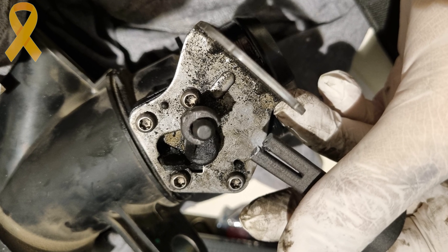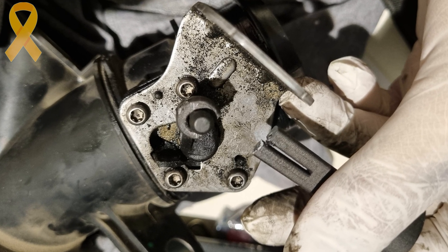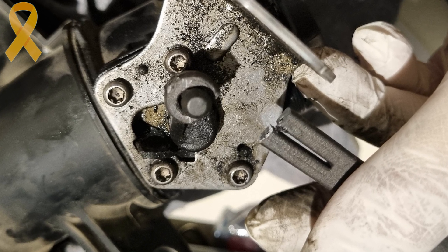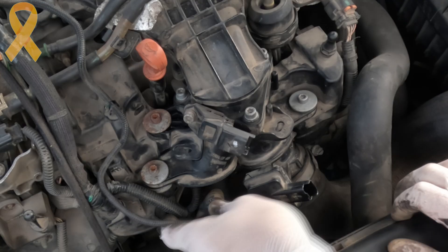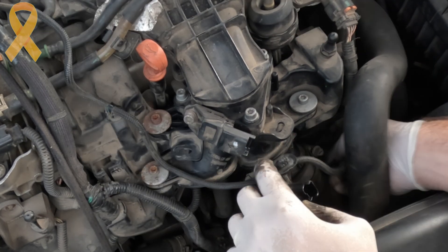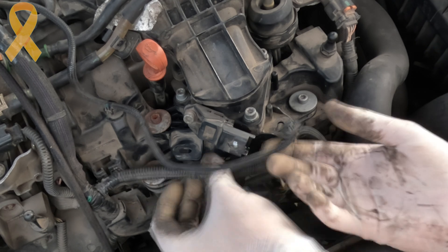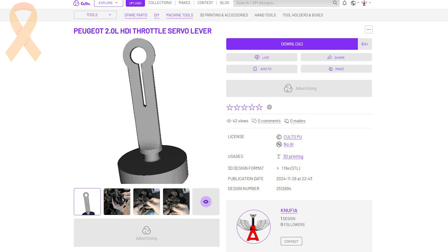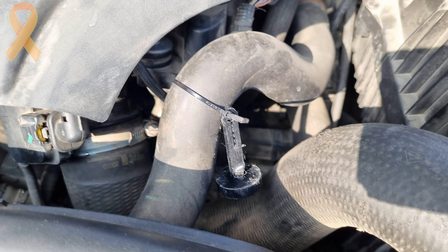At first I made the lever from a heavy duty industrial material called onyx. It's heat resistant but too stiff, so when I connected the arm it broke. For my next attempt I used PETG, and I also made a few adjustments to the model itself. I increased the outer diameter by a millimeter at the point where the plastic had broken, and added an additional 0.1 millimeter to the center hole. The PETG should handle the temperature in the engine bay, and in any case I attached another 3D lever with a zip tie nearby to check for any deformation.